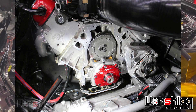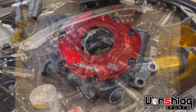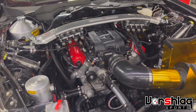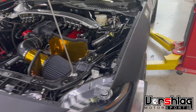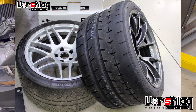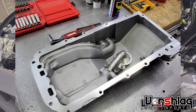What we had before was this LS7-based internal pump that's behind the timing cover — it was a two-stage K-tech with an LS7 pan. The pan has some detriments and just didn't have enough suction. Past about 1.5 g, we're starting to see more cars that came with this LS7 system, like the Z28 and the C6 Z06, start running into the same problem with modern tires.